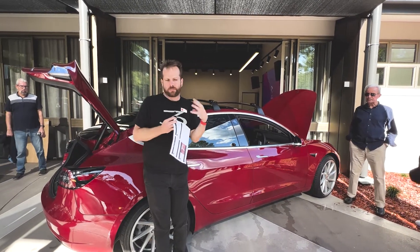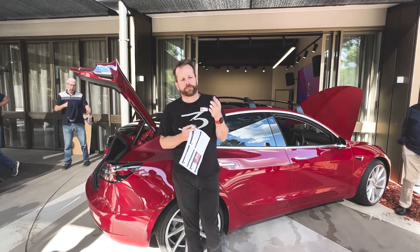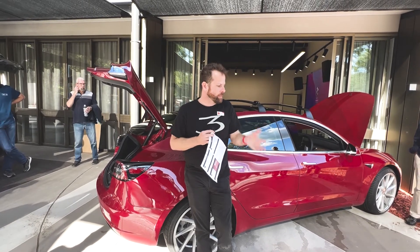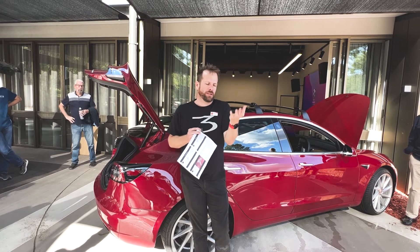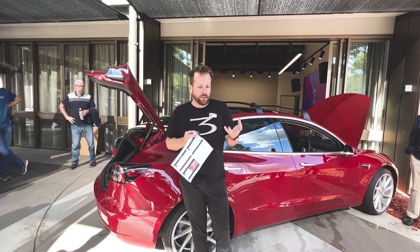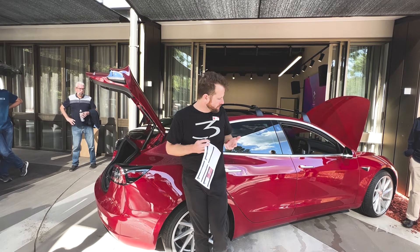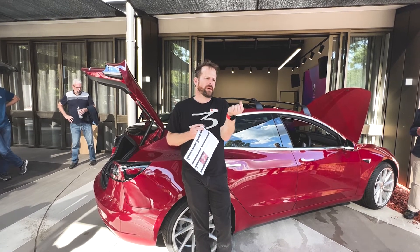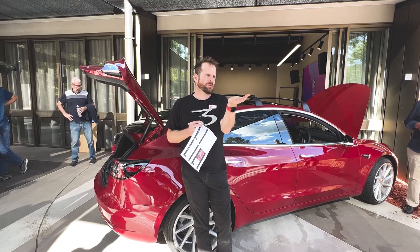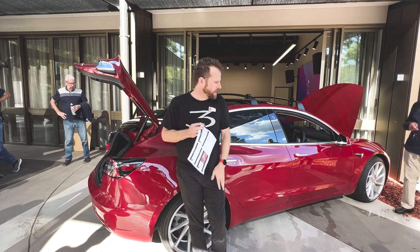Along the sill of the car there are a couple of little circles, and those are where you should lift it — on the face of those little circular holes. A lot of people say you need special lifting puck adapters, but you don't. They help by making an obvious spot to lift from, but they're not necessary — Tesla themselves don't even use them. What you do need is a flat rubber surface that interfaces at those holes to lift the car.